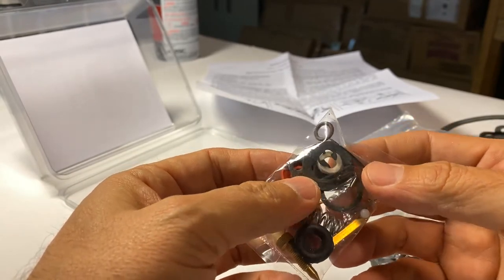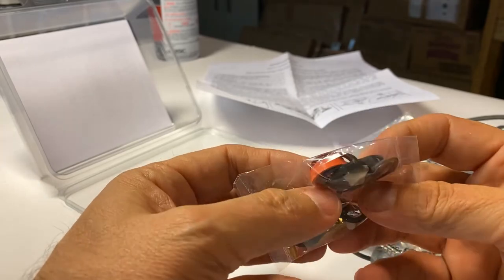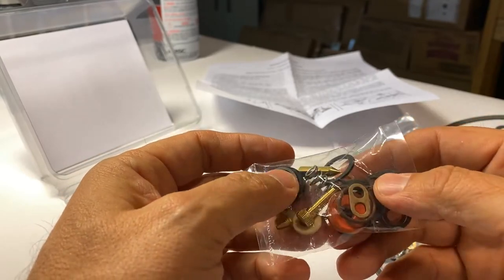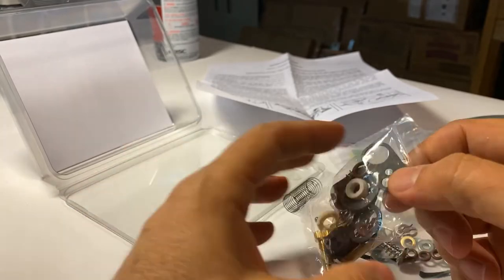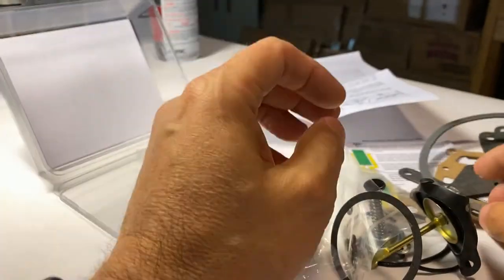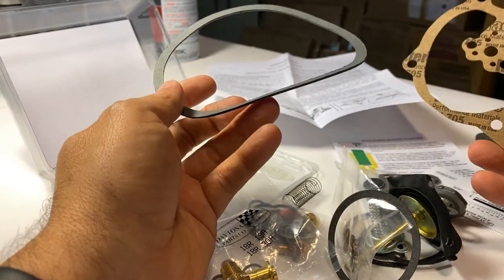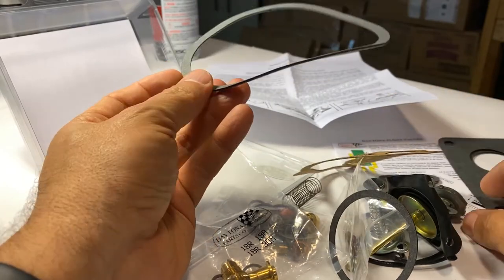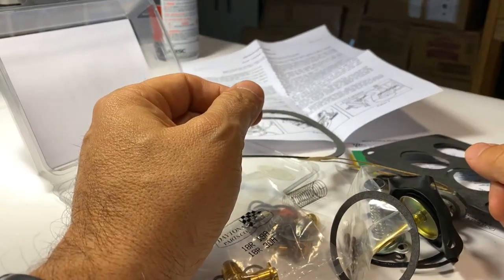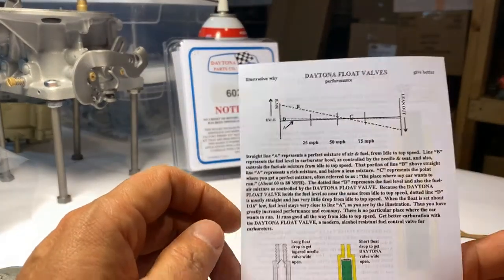You've got a nice grommet for your hot air tube that comes up from your manifold up underneath your throttle body — that's important. Some necessary gaskets and all that kind of good stuff, and these things are all ethanol-compliant, which is very nice and very needed in 2020. Overall, I can tell you I highly recommend the Daytona kits. They're very nice and very well put together. This one here is $78, and then including shipping I think it's nine bucks, so roughly about $90. It may seem like a lot, but it's very much a quality kit.